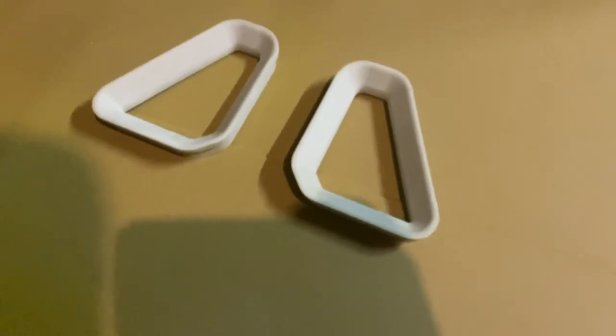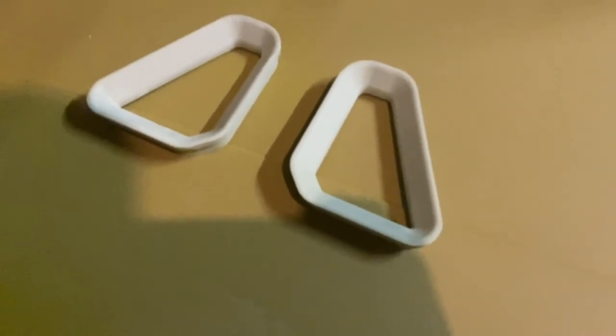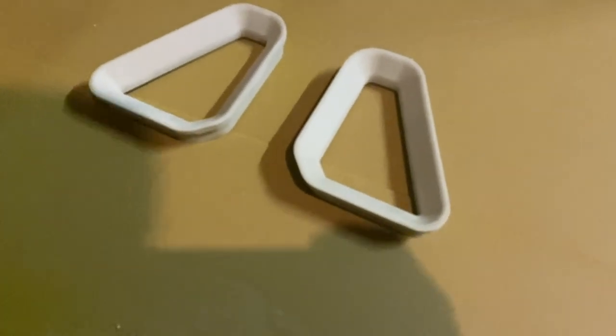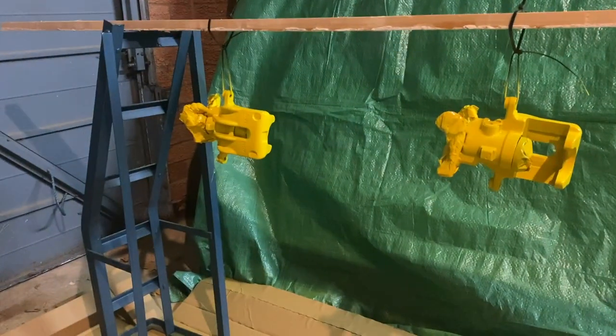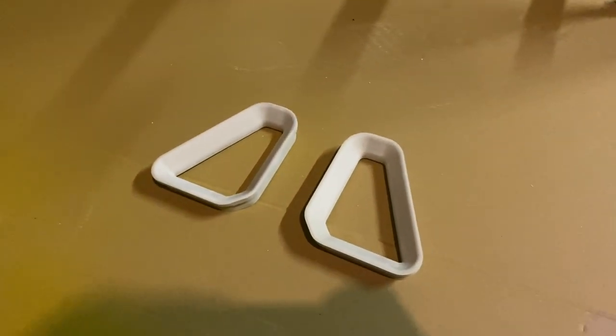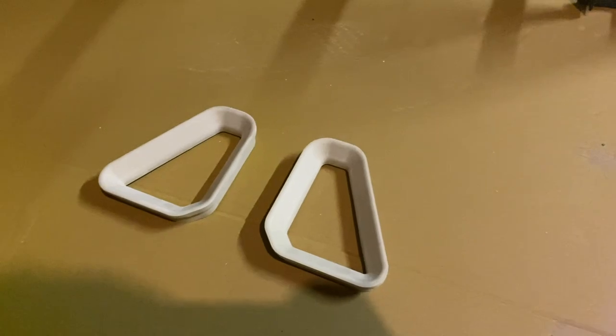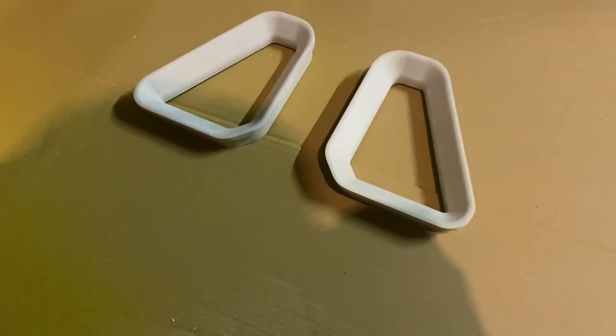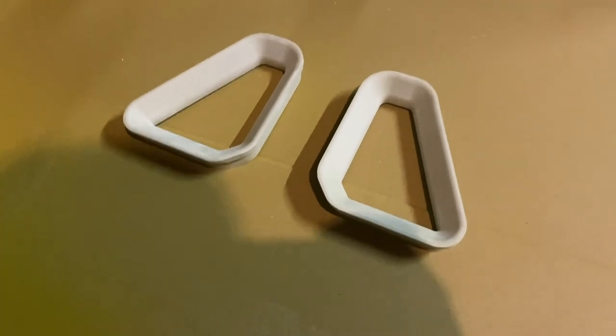So it's time for me to clean these down with some panel prep, hit them with one more coat of that spray putty, and then we'll go through the plastic primer, the gloss black, and finally, clear lacquer. But like I've said plenty of times, you guys have watched me do so much painting lately, part of the reason why I haven't filmed me painting these. So we're just going to throw the time lapse on, and you can just watch me fly through this nice and quickly, and then we can get to wrapping these, if we're going to wrap them. Still haven't decided yet, but we'll find out once these are painted what I'm going to do with them, and then finally we can get them installed.